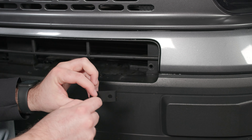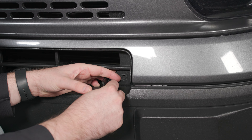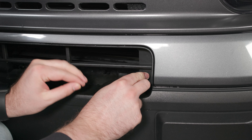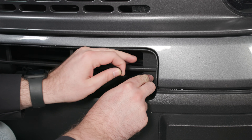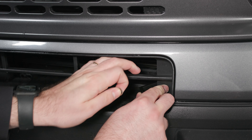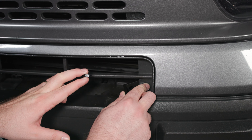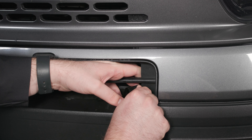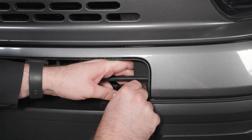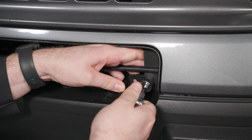Now that we have our hole drilled, you're going to want to take the bracket back off the bar so we can first mount the bracket to the truck and then go back and mount the bar. We like to slide it behind this location so that the bar sits back a little bit further. Run your bolt through there and take your included hardware — go on with the washer first. This is a tight space so just be patient. We're going to take our lock washer, put it on, then take our nut and start tightening this down. We'll take a size 14 millimeter wrench and tighten this all the way down, then do the same thing for the other side.